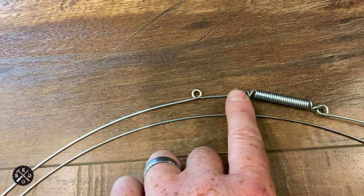That is the rear spring we put on next. Get it started in place — this second loop here is for the spring pliers, but it doesn't seem to stretch it far enough, so I'm going where I took it off: the end of the spring on one end and the end of the band on the other end. Just stretch it out. If you get tired, let off and take a break then redo it. Once it's in position and fastened, just make sure to check that it's in that channel all the way around — check it all the way down underneath and all the way around.